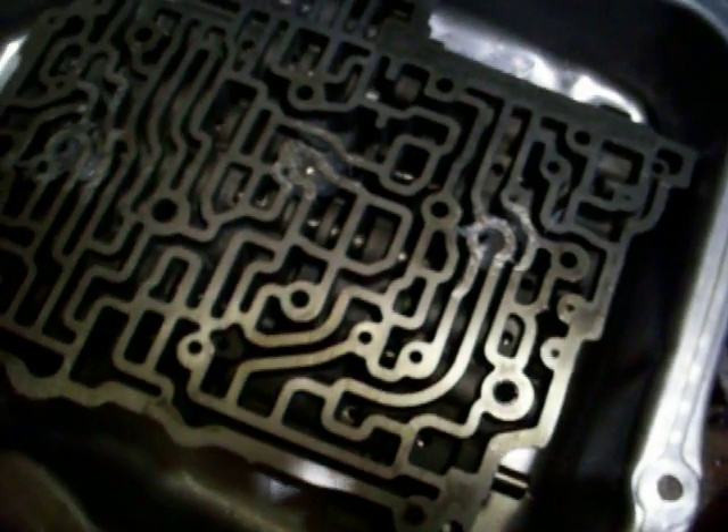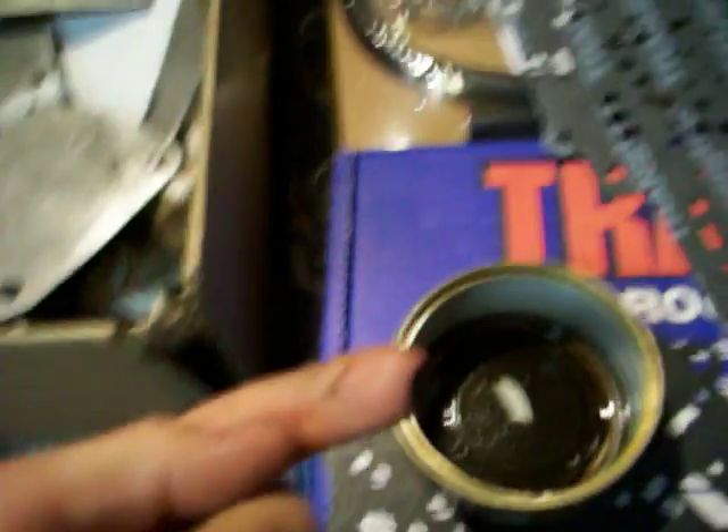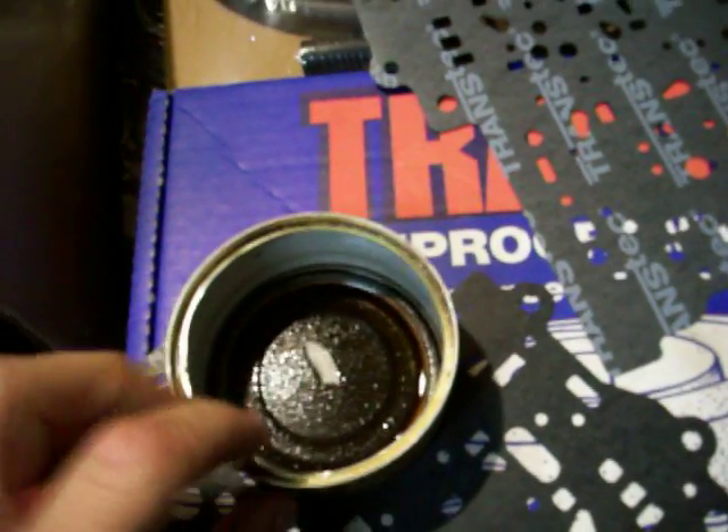I've made the modifications in the valve body. Just to show you, I promised I would show you some of the dirt left over from when I cleaned out the valve body. All this dirt and sludge was what was inside the valve body of this transmission. We saw how it looked clean the last time, but it really wasn't. Kind of interesting, because this stuff could be circulating throughout your new transmission.